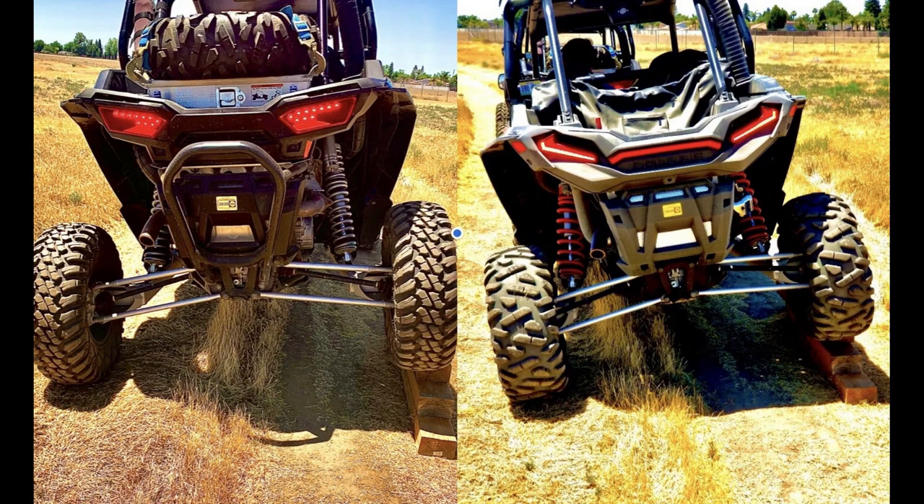That is stock suspension. If you look at the RZR on the left, it's sitting on the same spot of dirt — the same 12 inches of boards — and there is very little leaning of the vehicle. The camber of the tires is almost perfectly 90 degrees, the radius rods are at a desired angle, and the vehicle's suspension is raising up instead of leaning and becoming off-camber to the left. This is the effect that the Walker-Links have on an RZR — very, very nice addition.